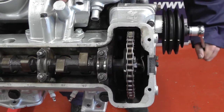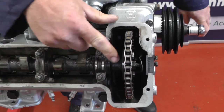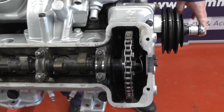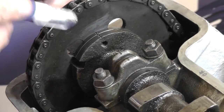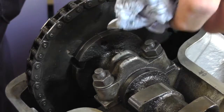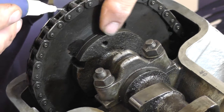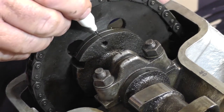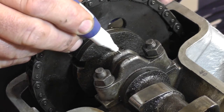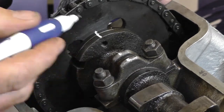I'm just going to turn it round. Hopefully when this lines up, the line on there will line up with the line there — same on this camshaft here. The two timing marks on this side I haven't tipexed yet, but if we just clean the oil off you'll see the line just above the hole where the screw goes in. Using a tipex marker we can mark that and the two little grooves on there — they should now be more or less in line.